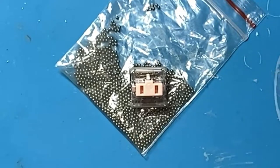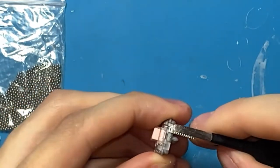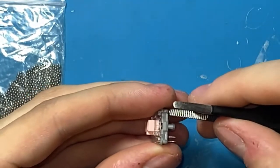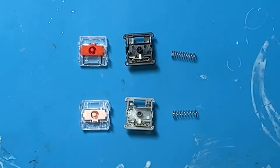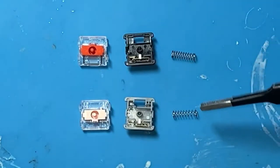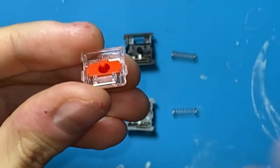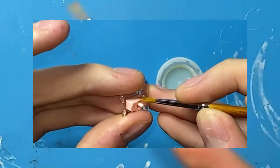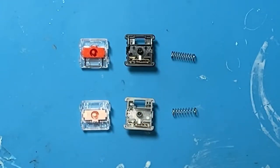Ball bearings are hard to find a lasting link for, so Google is your best friend. I'm going to do Pinks for this build. Take some tweezers, stick it in the leg, lift this side up until it's all unhooked, lift up one leg from this one and that one — you should just be able to pop it off. There's not a lot of difference between Reds and Pinks, but Reds have this little stabilizer bar that rattles around in the switch like a little maraca. You can lube your switches — lots of keyboard people do — and I like to because it makes them sound better.